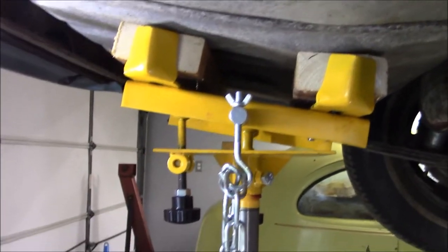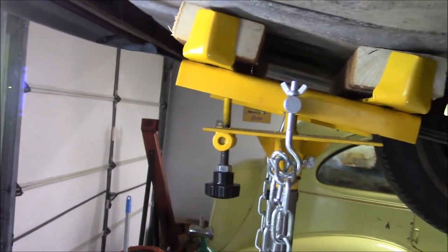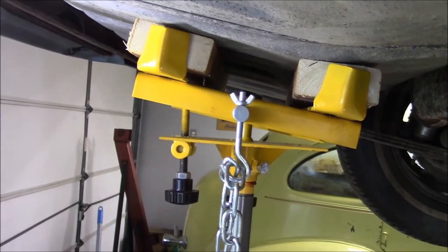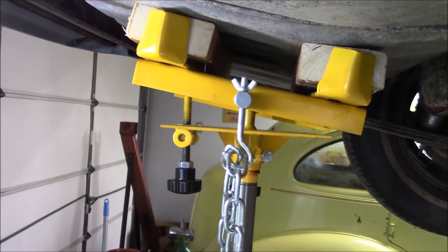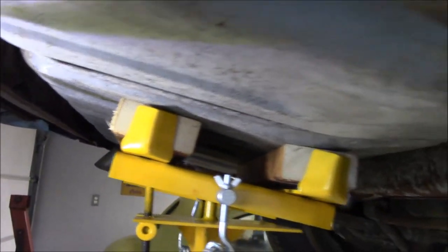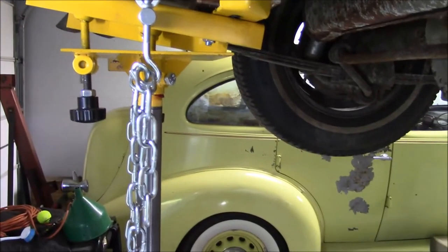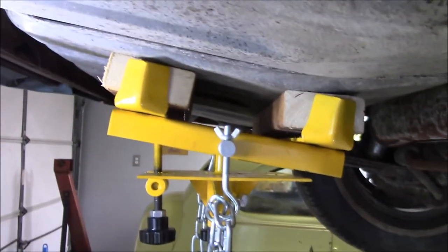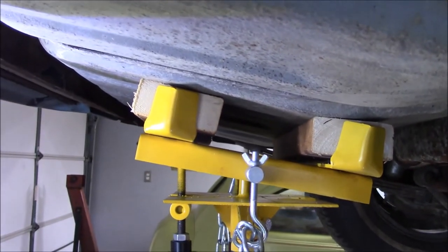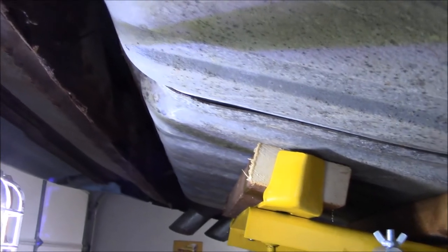You can see we've got our transmission jack — I put these blocks in here so they weren't resting on the gas tank and causing a dent. If this tank isn't too bad internally, I'm going to reuse it, clean it up and paint it. I know they make new gas tanks, but aftermarket ones aren't as good as the original. That Hudson over there — that tank is unavailable. I used a POR kit on it back in 1997 and to this day it hasn't leaked, so if you do the prep right you can save these gas tanks.